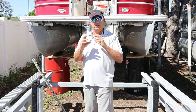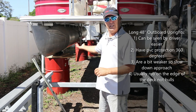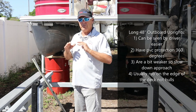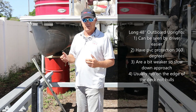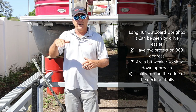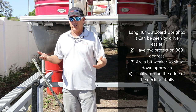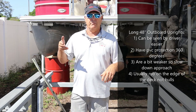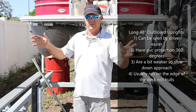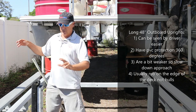If you compress the hull sides from these shorter uprights, you're making the tube shape change — going from a nice round aluminum shape to a pressed-in or flat shape. The more you change the water flow, the slower you'll go. You want a fair shape — a straight, rounded shape without hollows, waves, or weaves, as those would slow it down.